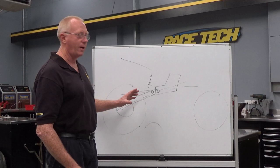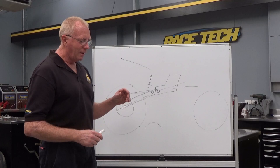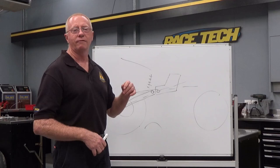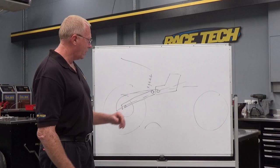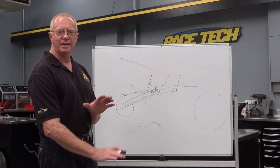Now, if we think of the tension that we put on this spring — much like tuning a guitar or a piano — basically we're going to want enough tension to allow us to hit the right note. If we were tuning a guitar and we had very little tension on it, the note would be very lazy. We'd tune it until we hit that sweet point, and then if we went beyond that sweet point, everything would become harsh and shrill. And it's just like us with our ride quality. If we put too much preload on a spring, it's going to get harsh and skittish. If we have too little preload, it'll be quite lazy, and when it's lazy, it doesn't push the wheel back down on the ground to give us the grip that we're chasing. So spring selection becomes very, very critical.